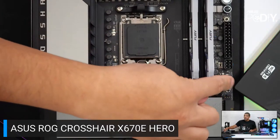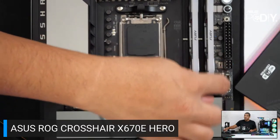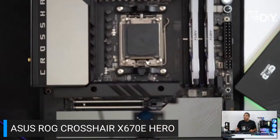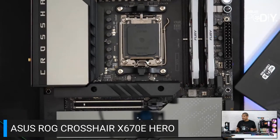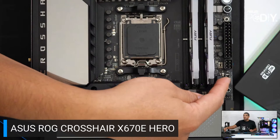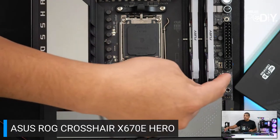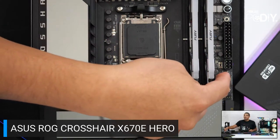One common question is why there's a six-pin connector underneath the 24-pin power. That six-pin supplements power for the front USB header — if you connect it, you can support up to 60 watts of fast charging. This lets you fast-charge devices like the G14 laptop, a ZenBook, Vivobook, or the ROG Phone 6 at up to 60 watts.